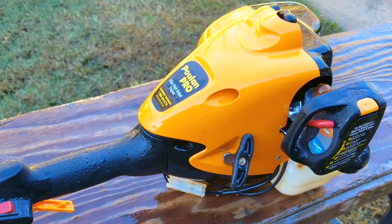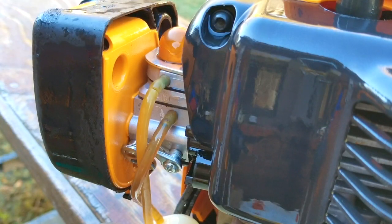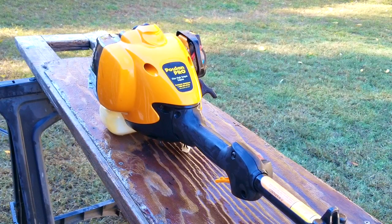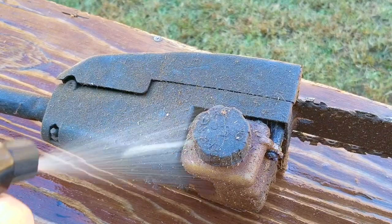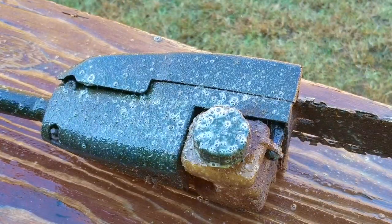As you can see, after getting all that dirt and grime off the engine, you can see it's in really good condition. I don't see any scuffs or scratches on it, which means it wasn't used all that much, which makes the mystery of why the engine is stuck even more compelling. As shown on the screen while I was spraying off the engine, I'm using a repurposed paint sprayer and the reasons are very obvious. First, since it's a medium pressure, I can hold it with my hands and not worry about getting hurt, unlike a 1600 PSI electric pressure washer. The other reason is low water consumption. Nothing wrong with using a garden hose, but after 30 minutes of spraying, the ground gets extremely saturated with water, which doesn't happen when using the paint sprayer.